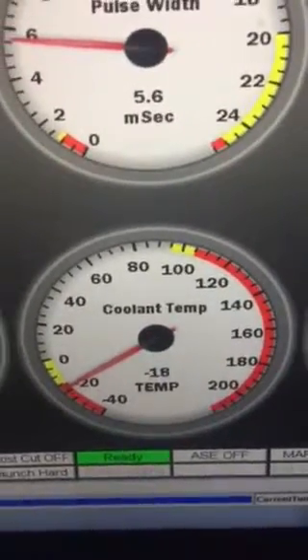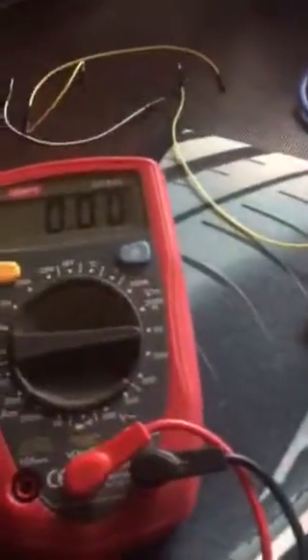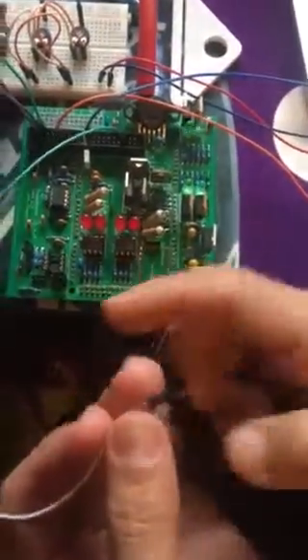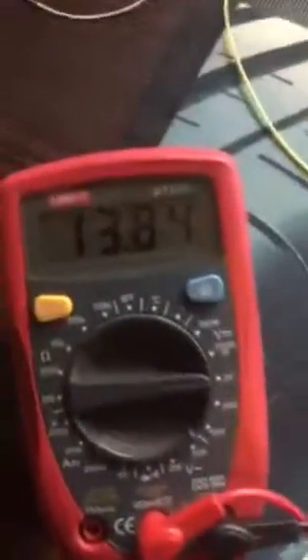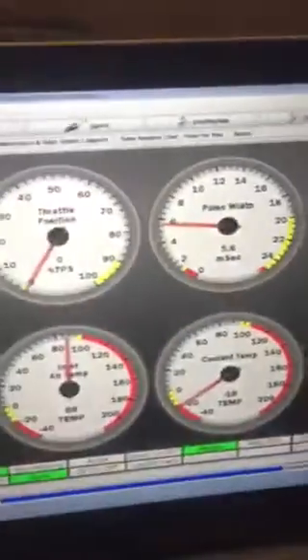So we're expecting that at 85 degrees — or 88 degrees given the 3 degree hysteresis — the multimeter should read 13.8 volts, which is what the power supply is pumping into the unit. The audio system is running and we're idling at 850 RPM. Let's connect pin 38. There it is: 13.85 volts. But hang on — that's a problem because I'm sitting at minus 18 degrees.